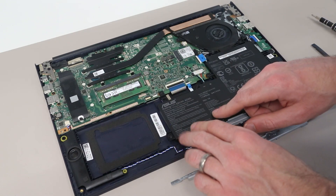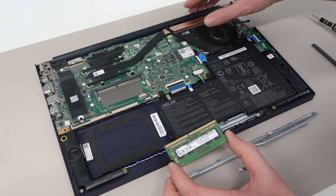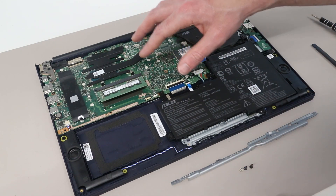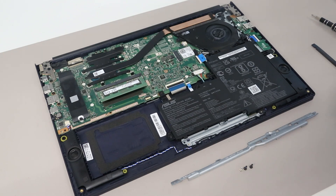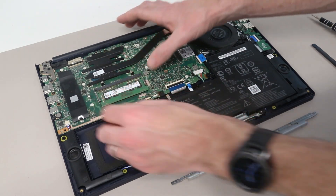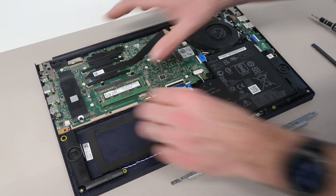In terms of what we can demonstrate upgrading, we have our 4GB memory module here, so we can remove this single SODIMM. The other 4GB is, however, soldered to the main board, so we cannot replace that. Our options would be going from a dual-channel balanced 4+4 configuration to an unbalanced dual-channel configuration — so say 4+8, 4+16, and so on. Installing these SODIMMs is very easy: simply pull these two side clips, slot the DIMM out, and then to replace, slot in and press down.